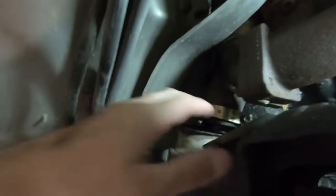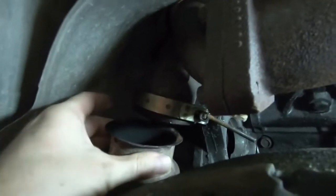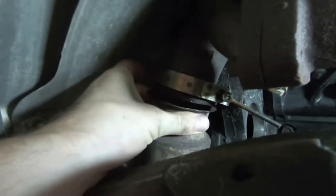There's nothing back there because you've got your turbo right there, and then the exhaust drops right down and back there. So everything is literally over on this side, which sucks. I had to use several extensions — about a foot and a half worth of extensions and a 15 millimeter socket to get the two bolts out, mainly the bottom bolt, plus a couple little things to undo the electrical. Once I dropped the exhaust I had to push it down and out and wiggle it through.